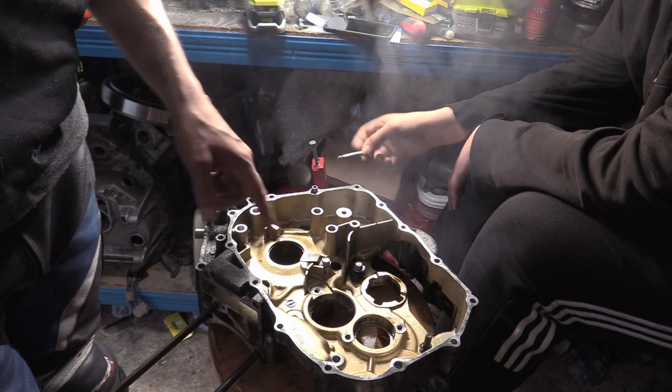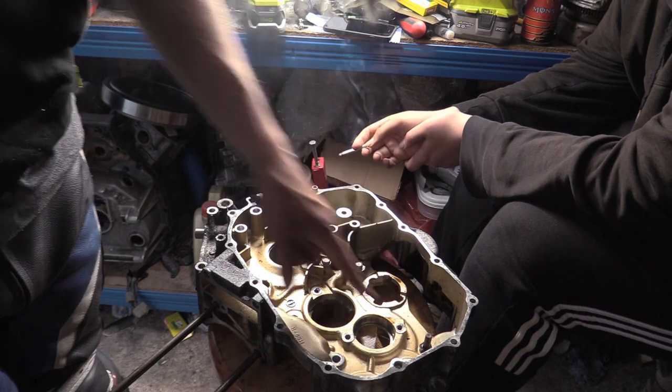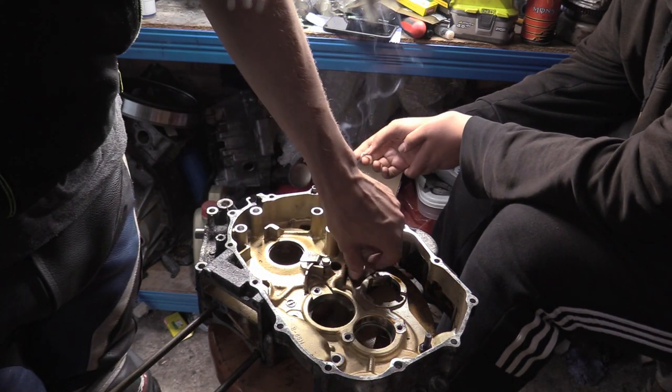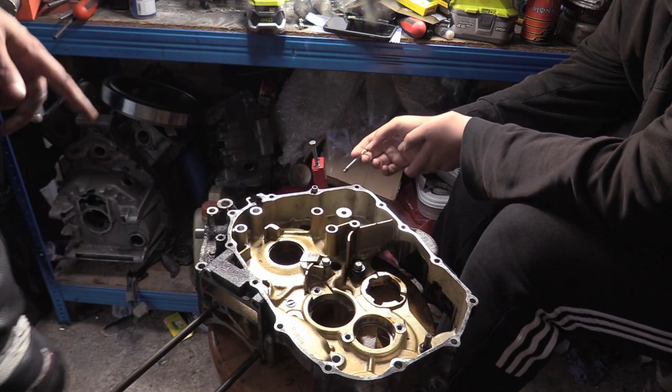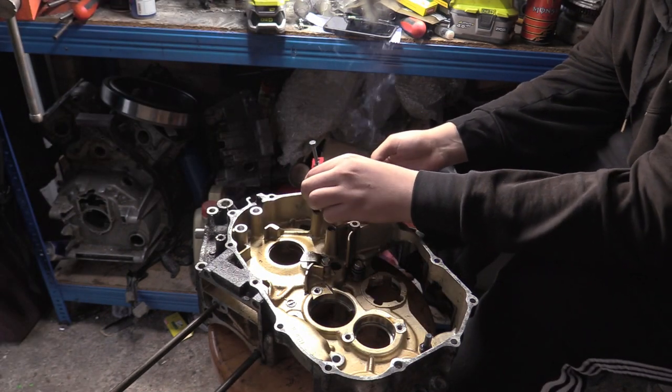All these bolts, and give it a first rinse, with that post there for the selector fork mechanism. We can leave that in there. We can take that spring, that's all loose. Take this off. Take that out. We can leave that in there for the time being. You can leave this post in because it's been torqued up and locked tight. You don't want to really touch it.